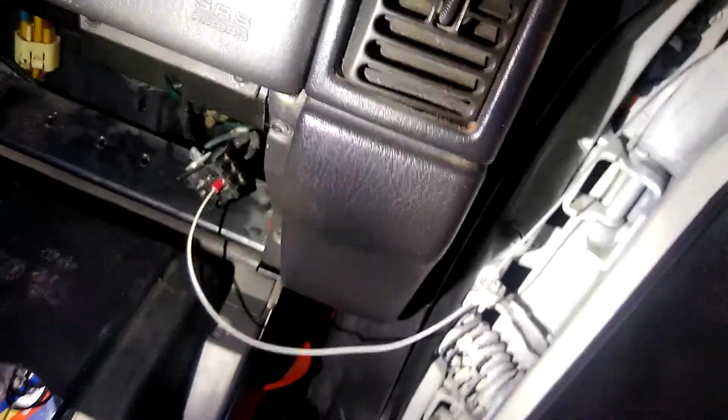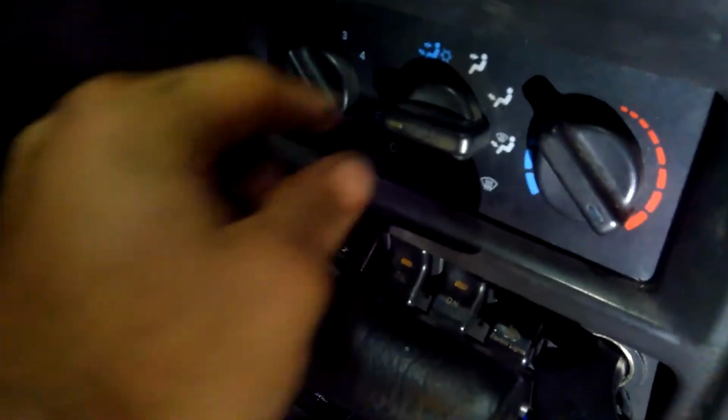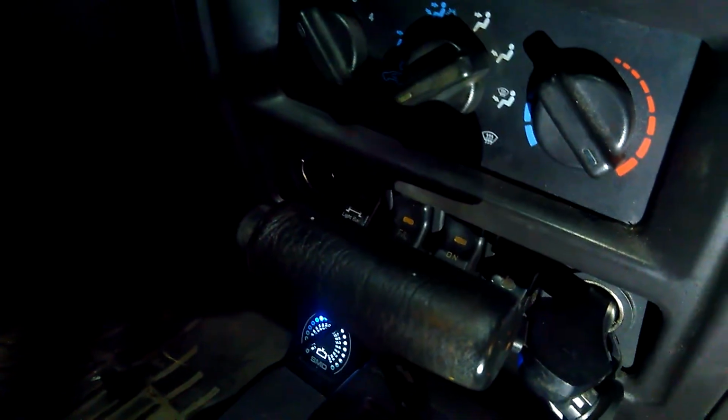And then to switch on the harness, all I did, I came back and I found the signal pin on the original relay connector. And, mind you, obviously I'm not running it this way. This was just to test it out and to prove it works. I'm going to just pull the signal out of that. And as you can see, let me go put that wire back real quick. Wiring it up this way using that relay harness, you maintain speed control. And it also shuts off whenever you turn off the actual AC controls.